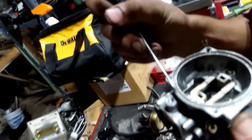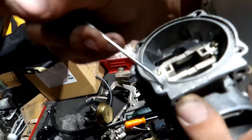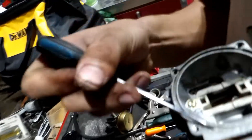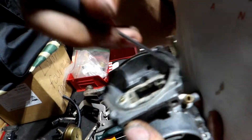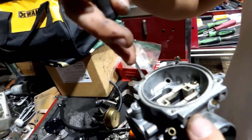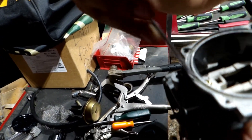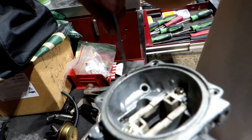One other thing we got to do is clean the scuzz where that diaphragm sits. Usually what I'll take is my tool of choice and just scrape around there — it's basically just dried up, I don't know if it's ethanol bacteria or what. I'm just taking a flat blade here and just scraping some of that out — just helps the diaphragm seat. Obviously you want this flat so it'll seal again. Then what I'll do is take compressed air and just blow the remaining debris out.